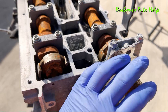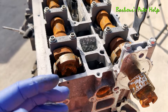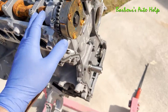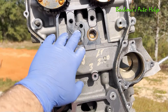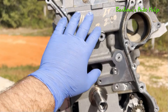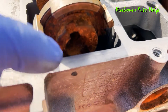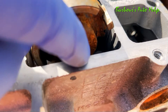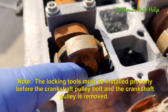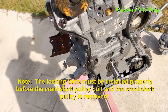Now, if your high pressure fuel pump drive is still on, you can just take a blade and hold that one still, have the peg inside the crankshaft, and service a front crankshaft seal or the timing cover — you don't have to take your high pressure fuel pump drive off for those simple jobs. Now, going back to the front here, there are two top dead centers you can have for cylinder number one. If it's not TDC on the compression stroke, the slits on the back of the cams won't allow for the tool to go in. The slits are offset just a little bit so that when it's on TDC of the compression stroke it will allow the tool to slide in. Otherwise the slit is going to be below the deck surface and you won't be able to get your tool in — in that case you'll need to rotate the crankshaft 360 degrees and reset everything.